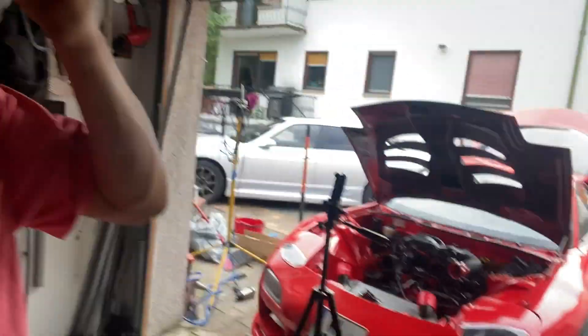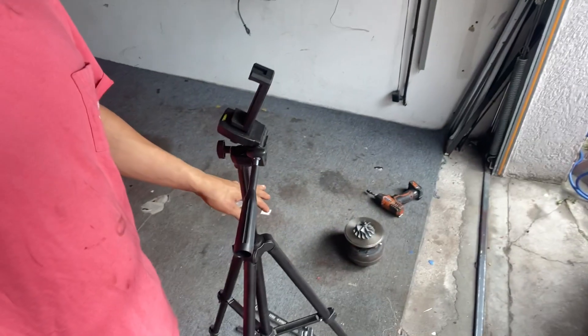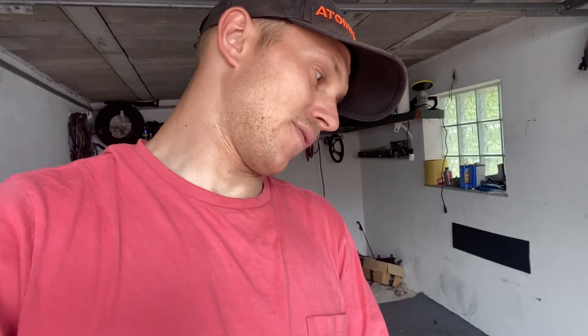I was gonna go with the EFR turbo but honestly I just can't justify spending 2,200 bucks plus on this thing. I'd have to put coolant feed and coolant return lines in to feed that turbo because this one's only oil cooled and the EFRs are both oil and coolant cooled. This isn't my main FD — it's just one I have here — so I need to save money for the three-rotor back in the States. I think we're just going to rebuild this one for now. Maybe I'll order another one on the side and toss the rebuilt one for sale fresh.